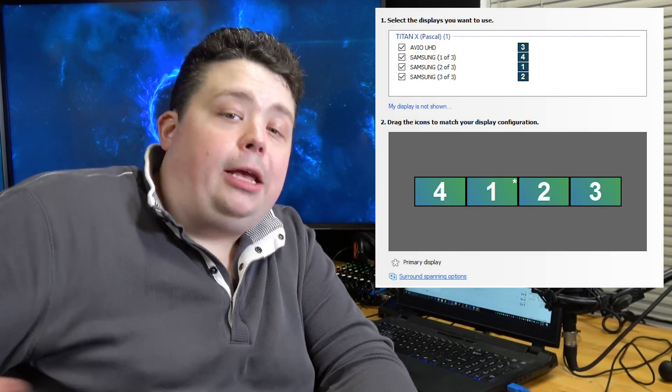There are a couple of different ways to connect this device. You can go directly from your video source — computer, gaming system, or camera — into the AVIO box. But the problem is there's no output on the box, which means you can't run a cable to a screen and also capture from the same output. What you can do is buy a cheap HDMI splitter through Amazon; those splitters allow you to simultaneously send an image lag-free to the display and split off another feed to the capture device. That's not necessary when capturing cameras, but if you're doing gaming that requires low latency, I'd recommend using the splitter.